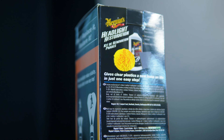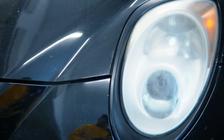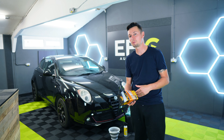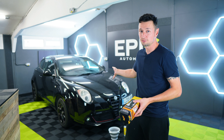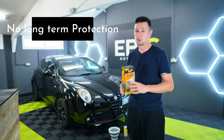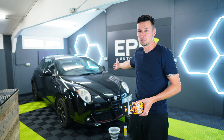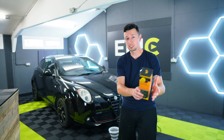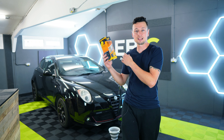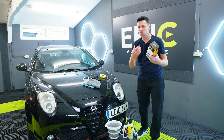Now that I've completed the test, what did I really think about the kit? Look, there's no question about it — the comparison between these two headlights is night and day. There are a few drawbacks though. Bearing in mind, this is just a one-step product — yes, you can get these results, but you're not protecting it afterwards. You are going to need some sort of UV protection, or give it six months and they're going to be back to square one. If you wanted to go one step further and protect your lights for longer, you can go for their second kit in the lineup.